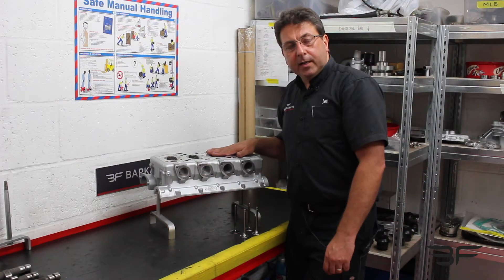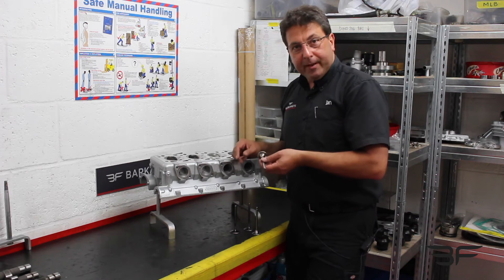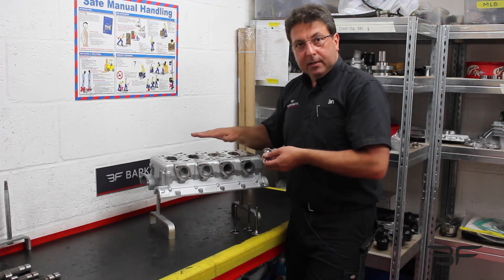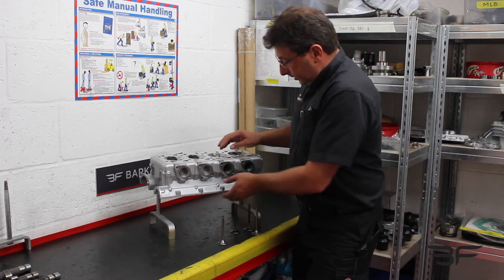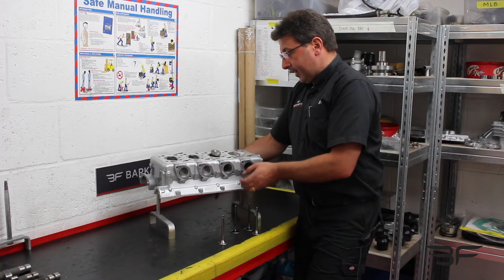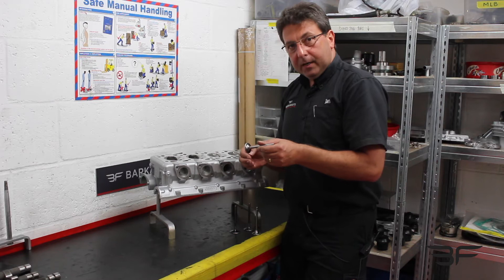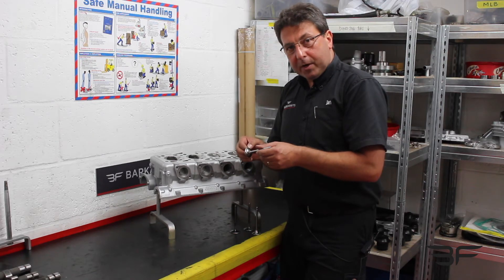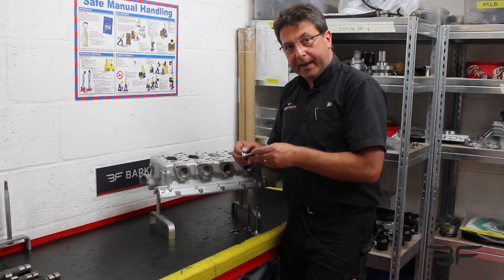So you've seen how we overhauled the cylinder head — we've got our new valve guides, our new valves, we've recut the seats. The next bit is just finishing off the seats so the valves move up and down nicely in the head with the new guides, but on the bottom there's a very fine seat. They were cut with a machine first off, and then for the final cut we finish them by hand.